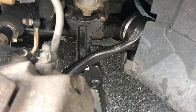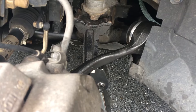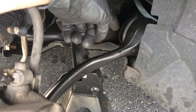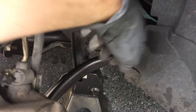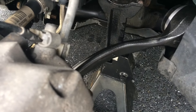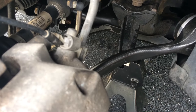One thing I'll mention is that when I got the new tires I noticed some vibration right away that I didn't have before. I think that's because the old tires were worn out so badly they weren't translating any worn suspension components or vibration into the car. So I went ahead and replaced this control arm — it was very simple. It just comes out, loosens up, there's one bolt that goes back here. On this side it connects into a ball joint, and that was a pain. I used everything to get it out and ended up taking it to a specialist who had the tools necessary to remove the ball joint from the hub.